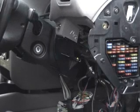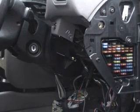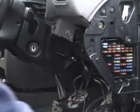I'm now going to disconnect each control unit one by one, checking in between the resistance to our diagnostic line, to see if it improves on disconnecting any of the equipment. I checked through all the control units and we found the fault. There was damage to the K line between the instrument cluster and the stereo. We've made good that wiring, reconnected the vehicle battery, and I'm now going to retest pin 7 at the plug.